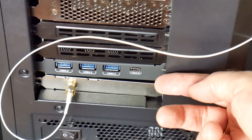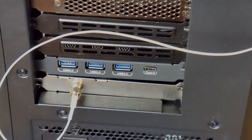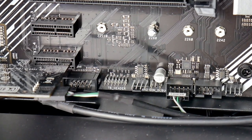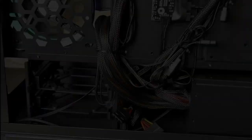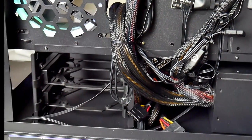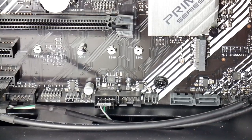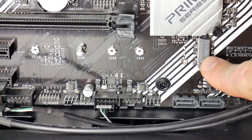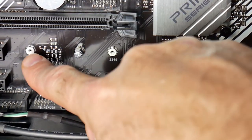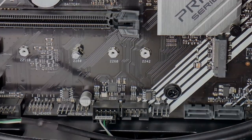Using one of the open PCI Express x1 slots I fitted a USB Type-C expansion card, as there wasn't one on the motherboard. Should you wish, you can also make use of the Thunderbolt 3 header on the motherboard to add that to the desktop. There are two 3.5-inch hard drive racks but no intake fan fitted to keep them cool, so I recommend doing that if you plan on installing some drives. The motherboard also has a second M.2 slot that is Intel Optane ready, accepting cards of sizes 22110, 2280, 2260, and 2242.